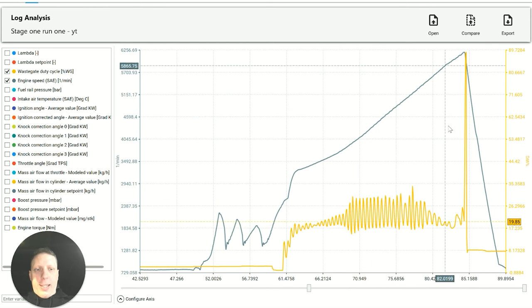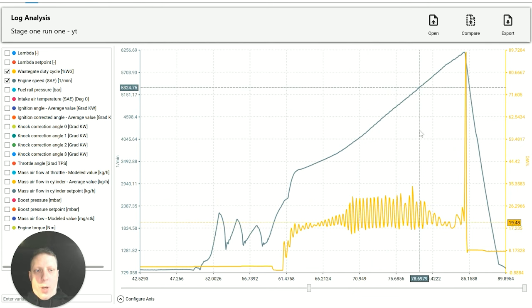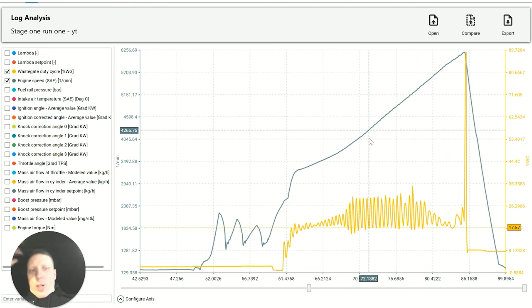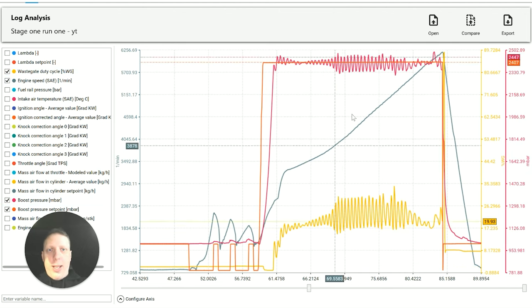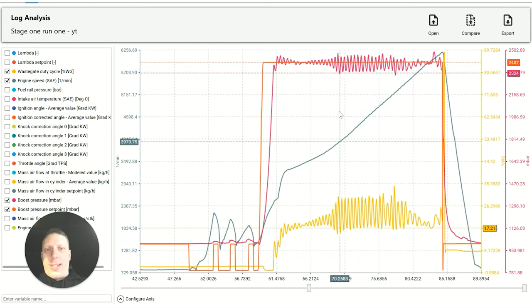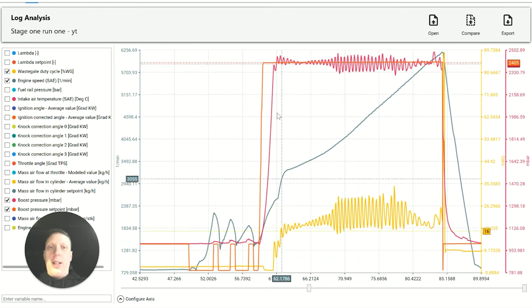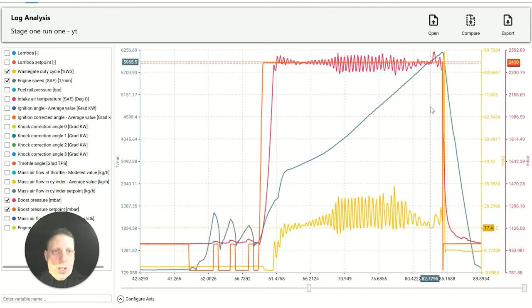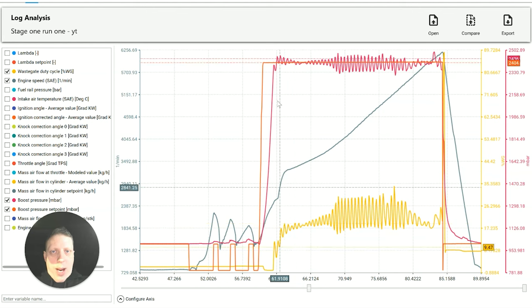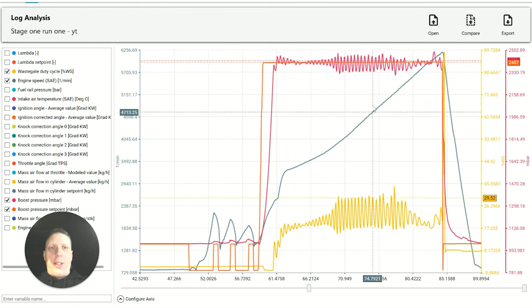What that basically means is I need to do a bit of work on the wastegate to get that to work. Because these work on like a pre-gate, so it's kind of like it targets something, and if it doesn't work, it works on the pin to drag it back, and it'll go again, drag back, go again, drag back, which is pretty much what's happening there. So the boost itself probably doesn't look too bad. Yeah, same again, look. See how the boost is waving? So the boost is waving when the wastegate's waving. So as the wastegate's opening and closing, so does the boost. You can kind of feel it as it's going through the run. So this is where I'm going to put my attention into fixing this.